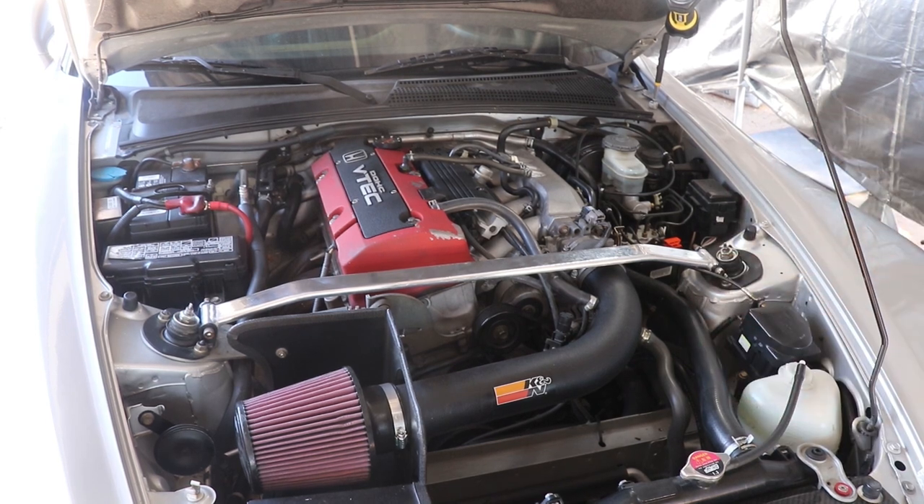The alternator is put back together - here's the old piece, so this thing is ready to go back in the car. I still have to work on extracting the broken bolt. Unfortunately that bracket is a 10-day wait from Honda, so I posted in the local S2000 page seeing if anybody has one. If nobody responds I'll order through Majestic Honda because it's a bit cheaper. Since it looks like that bolt has been broken for a while already, I'm going to try wedging the other bottom bolt and snugging it up enough to get me by for a couple days.